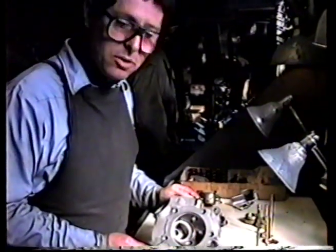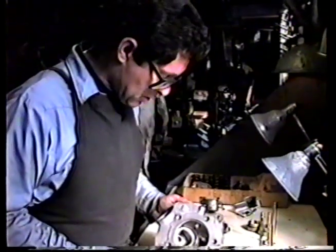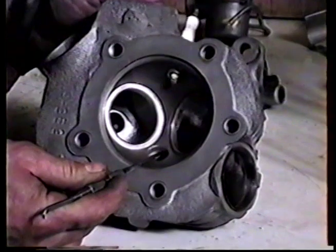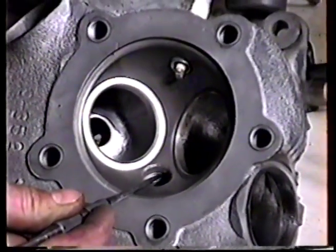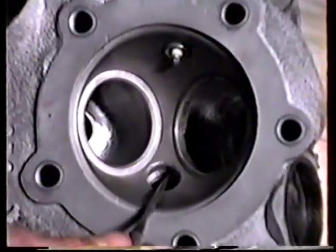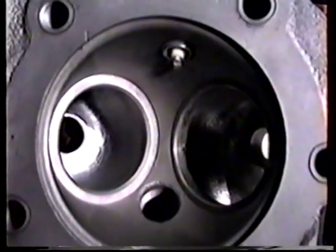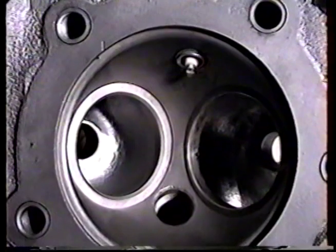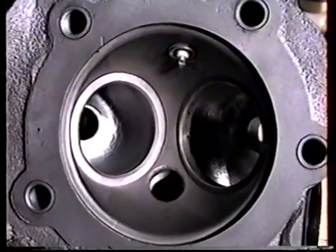There was something else I wanted to mention about this dual plug setup for guys that want to go the extra mile. We do make a reducer to size this big bodacious original knucklehead spark plug down to match the new size. We'll show you that later. So you can run all the same spark plugs in these knuckleheads if you'd like.